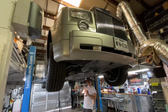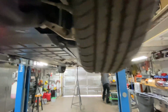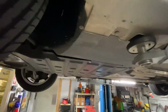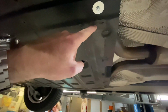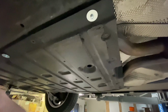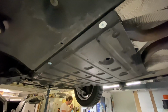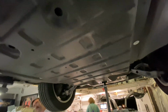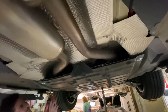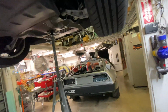I was driving down the road and the belly pan came loose. This protective cover here. I was moving excessively, let's just say over 100 miles an hour, and I heard a scraping noise. It didn't do much damage, a little road rash here. It just dropped down a little because some of the push pins fell out. So rather than using plastic push pins, we're going to use much more secure washers and screws to secure it a little better. The thing was fantastically, beautifully dry under here. So this is just a small little project that we had to work on. Sometimes you got to do that.